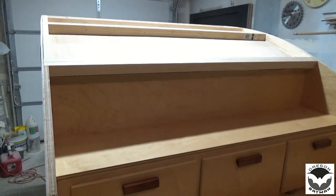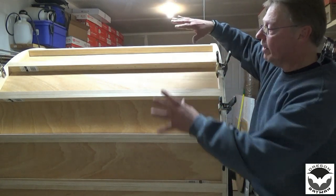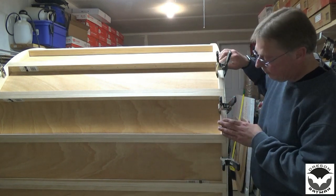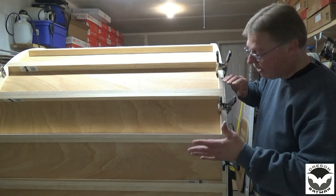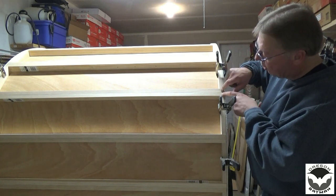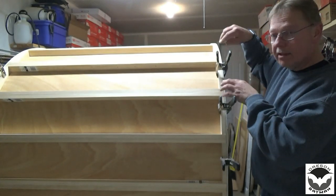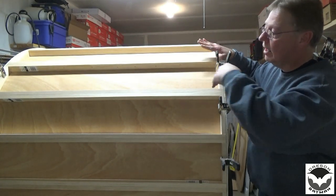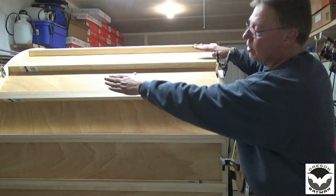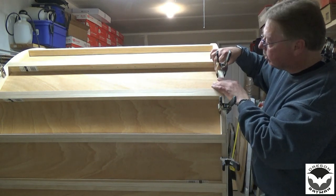Alright, so what are we going to do next? The next step is, now that we've got all of our spars in place, and we have all of our spacer blocks sitting in place, I've got these clamped so they don't fall out. The next thing we're going to do is start in the back, and start tapping holes in the end of each one of our spars, and we'll get those fastened onto the cabin itself. We'll have the adhesive on, put those in place, screw fasten them, make sure that we're sealed solid, and then one at a time, we'll go ahead and install our spacer blocks.